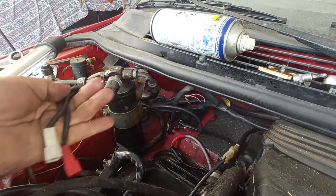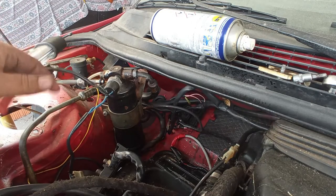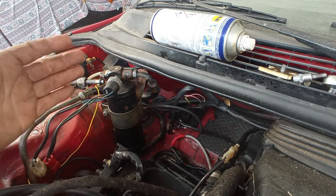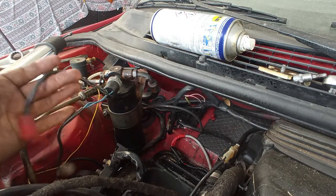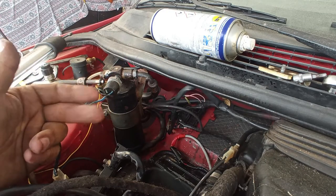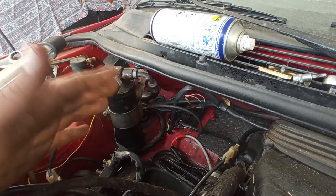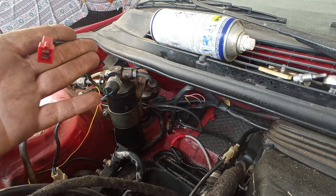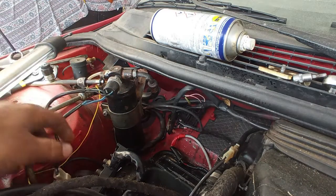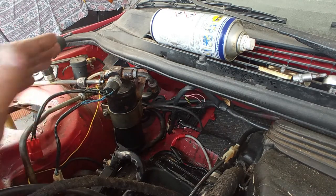This is the old pressostat for the position of the, well, it has two positions. The first one engages the clutch on the compressor. The second one engages the fans to kick in, okay? So if you saw on my videos about AC, you need a minimal pressure to engage the compressor. Basically, this is two switches in one, okay? The first switch clicks at about 5 kilos, or so, the second one at about 10 to 15 kilos. The first one will permit that the clutch engages. The second one, once the pressure reaches the 10 or 15 or 12 kilos, it will engage the fans to kick in and to lower the pressure in that process, okay?